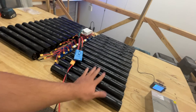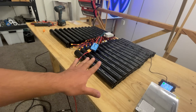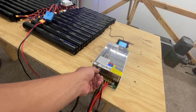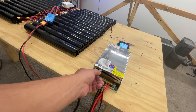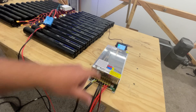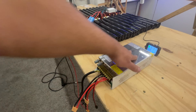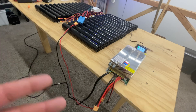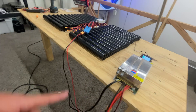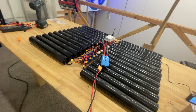This will take a while — it's 4.4, almost 4.5 kilowatt hours right now. Even if I put the charger at 15 amps out of 20 — because running at full peak isn't ideal, there's more chance of things breaking — at 15 amps it's going to take quite a bit, maybe 12 hours or 24 hours.